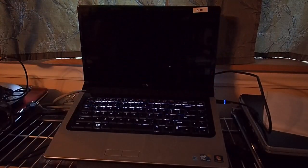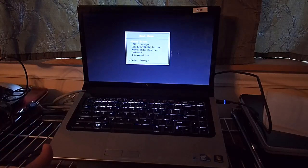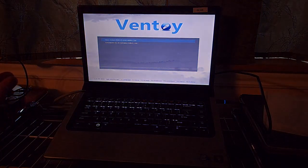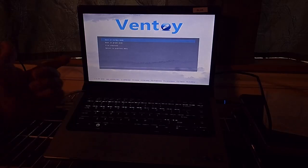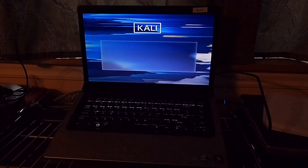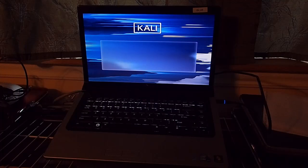Alright, so we've got our USB key. We're going to plug it in. We've got our Ventoy software on it and I've got two ISOs on it. Let's just put it in, power it on, and see what happens. This is my good old test laptop. I'm going to go to F12 — most systems have boot options there. I'm going to choose USB because I have that as a secondary boot source, and off it goes. VT loading — that's Ventoy. If I hit enter, it's asking me if I want to boot up in normal mode — sure, that's good enough, and off it goes. So that works pretty cool. I've now got two different ISOs on there that I can boot from, and Ventoy allows me to boot from either image.